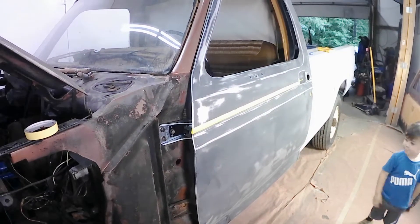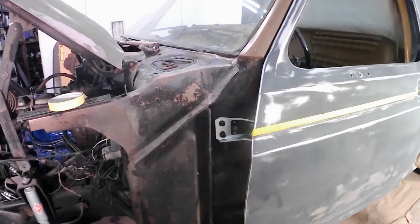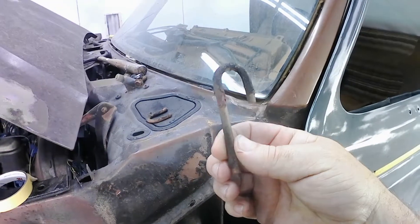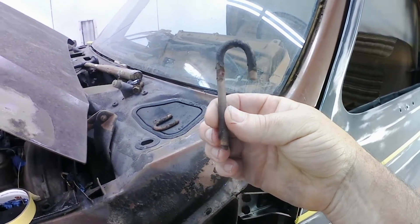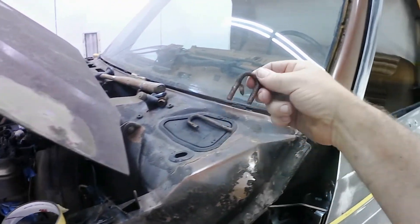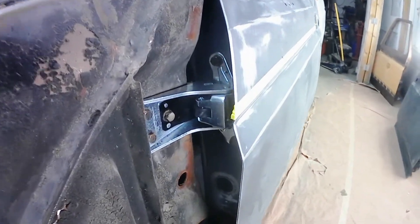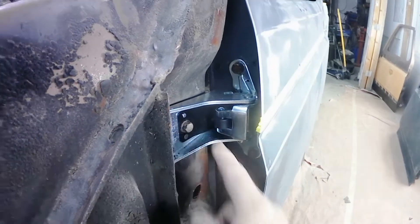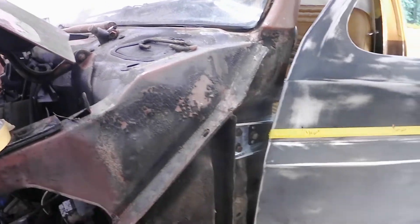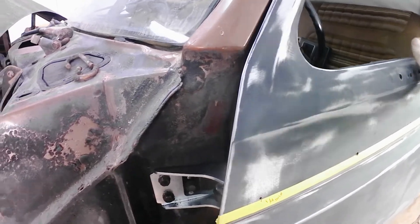I got the door back on the truck for two reasons. First, I bought a new upper hinge for the left side because the original hinge had a spring in it to keep the door from closing on you in the wind, but that spring is obviously not in one piece anymore. The new hinge has a different style — a roller with a spring — that keeps the door in position so it doesn't close just from the wind blowing. I wanted to make sure I got the hinge back in the proper position with the door alignment all lined up good.